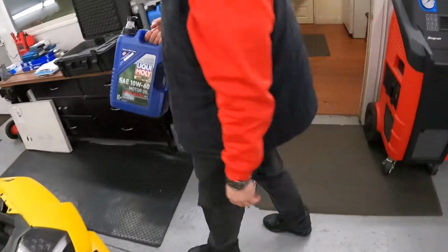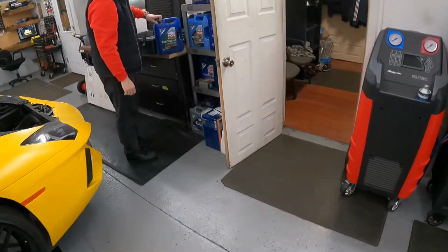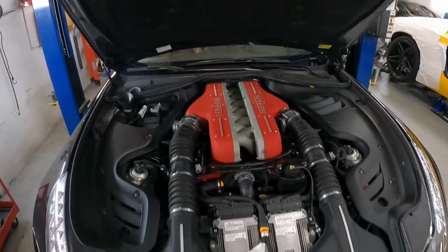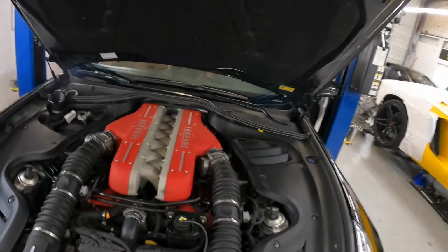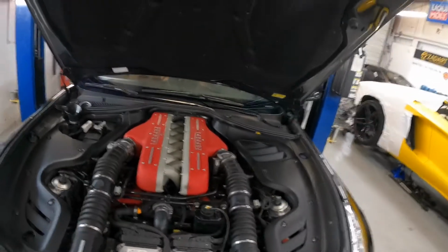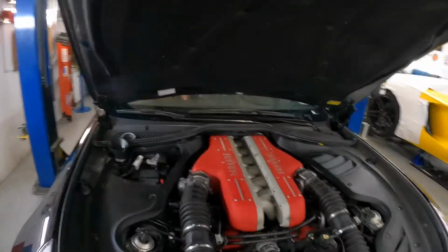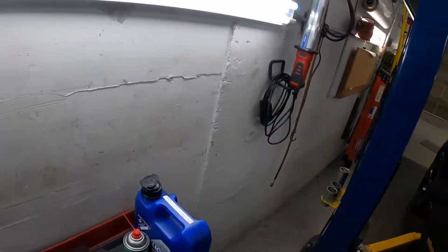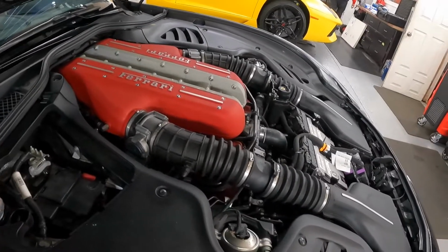Did you fill another 1.5 liters? Yep. Okay, no, keep going, we just need to adjust the level. First time we fill around 8 liters. And then fire up, check the pressure, keep running like 15 seconds, and then shut down. Added a total of 11.5 liters now, because we drained 11.5, and now it's time to measure and adjust the engine oil level.